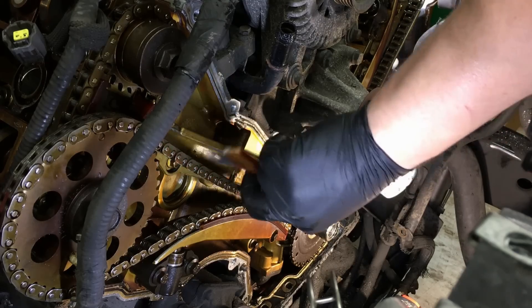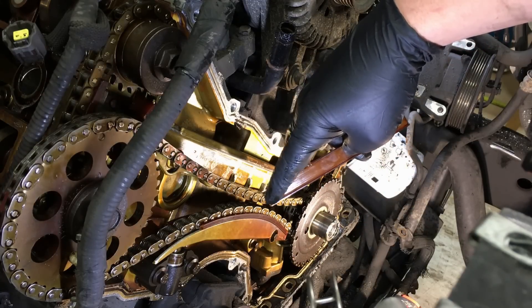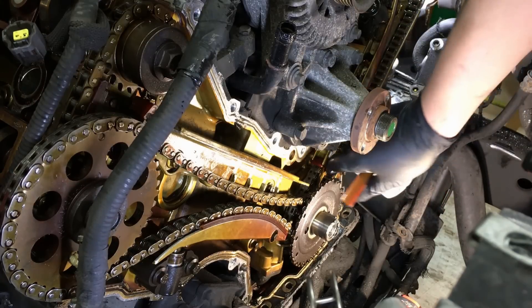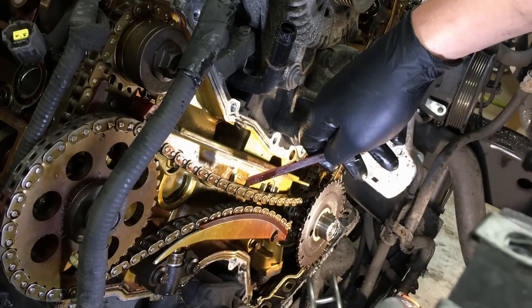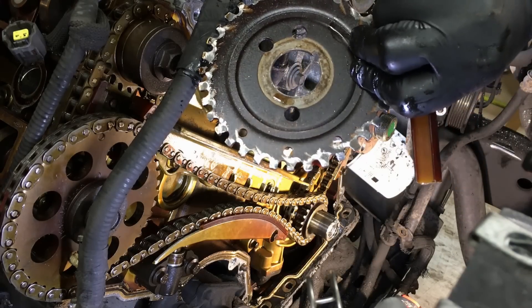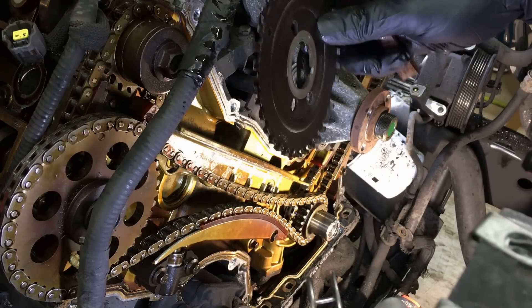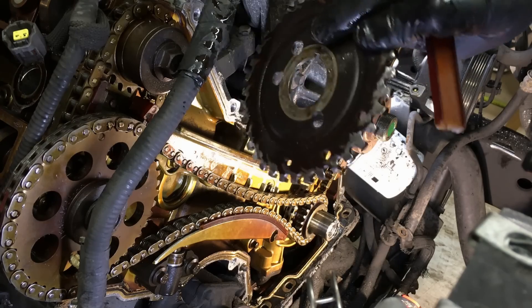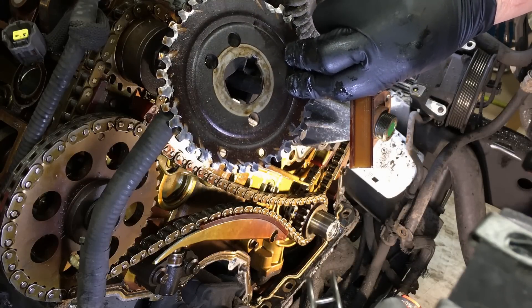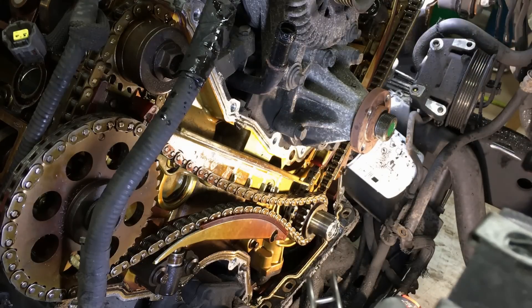At this point we definitely need to go into the pan and clean up that reservoir and of course the screen. This is really bad on this side. The chain is beating on the front cover — I'll show you that in a second — it beats on this and then beats on the back side here. That's one of the worst I've ever seen. This has been going on for a while — look at that, all chewed up. This is your tone ring for your crank position sensor. If it gets this bad you should be changing it out; otherwise a little wear on the back side is no big deal since it reads the tooth profile for triggering.